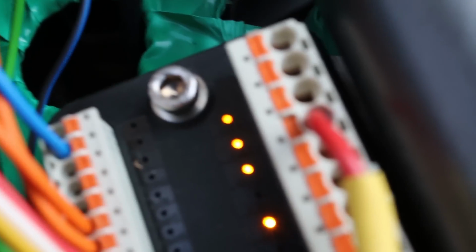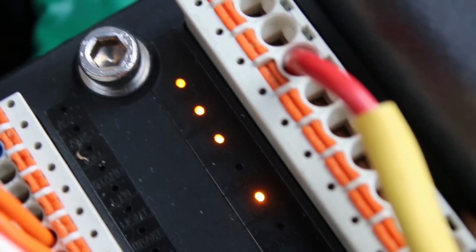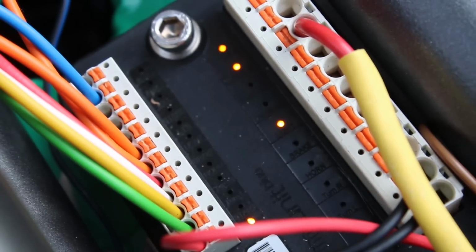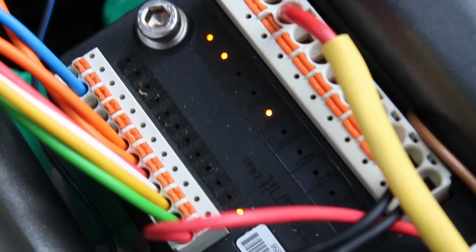So basically you turn the key, right? The ignition output automatically turns on. But if you double tap the start button even while the engine is not running yet, you can turn off the ignition output. Hell, you could probably even use the phone app to configure the M unit to not activate the ignition until you hit the starter button after you turn the key.